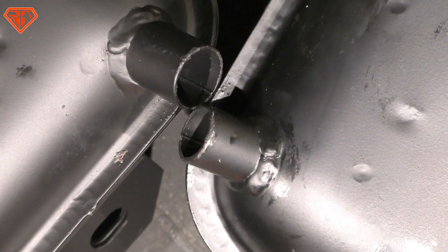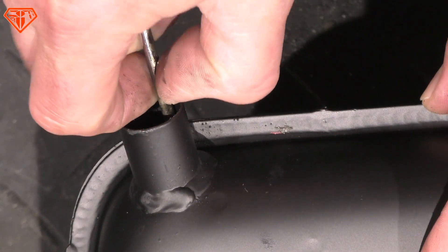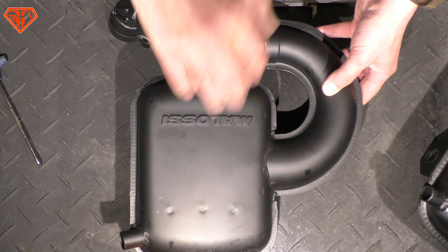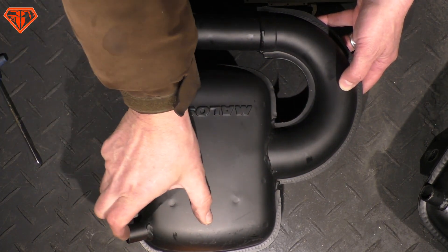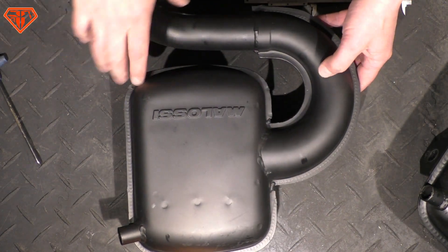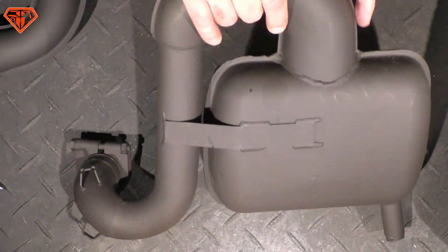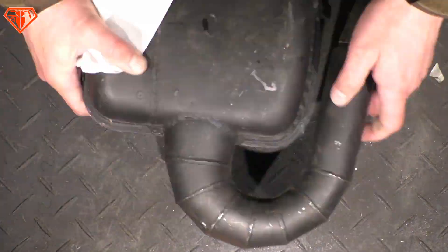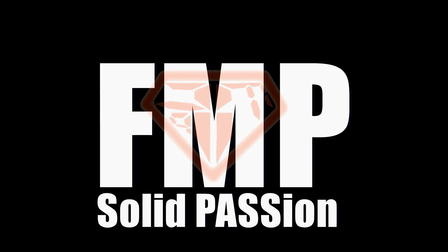Shall we see how long it is? Look at that — this is way longer. Conclusion: what we can see from the outside is the body is the same, but the tailpipe is 20mm instead of 17mm, and it is way longer. The Malossi has 80mm and the FACO Box has a 45mm length. Quite more.